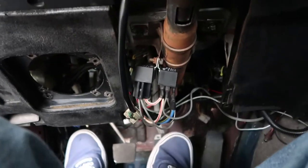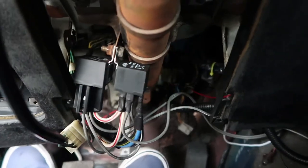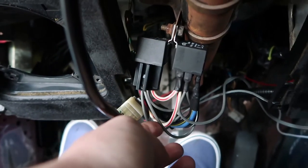We used all of the factory wiring. I talked to a few guys and everybody does it a little bit differently. Mike Osborne up in Canada would just run a switch to the starter and actuate his that way once the power is on. A few other guys just get rid of all the wiring completely in their race cars and run their own wires. What we did was use all of the factory wiring for the ignition switch - all we did was add two relays. These actuate each of the stages, so ignition clicks our first relay and start clicks the second one.